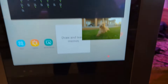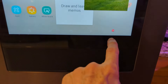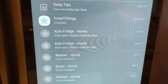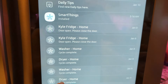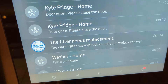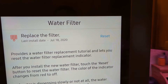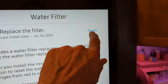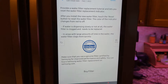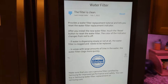Come down and click on your messages. Go up and you'll see the message that says the filter needs replacement. Click on that, give it a second, and there'll be a 'Reset Filter' or 'Buy Filter' option — we're going to reset. It's going to ask you to confirm, and it changes the date. The new date for the filter is February 7, 2022. That's it.